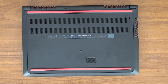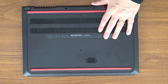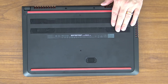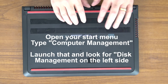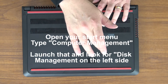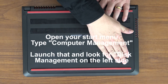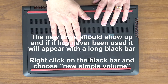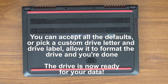Now if you bought a brand new drive, when you turn this computer on Windows sees it but there's no drive letter, because bare internal drives do not come formatted. You will need to go into Computer Management and partition the drive. Press your Start key, type in Computer Management, and press Enter. Go to Disk Manager on the left-hand side and you will see the disk listed below the solid state drive. Right-click on it, create a new volume, assign it a drive letter, it will offer to format it — say yes, and your drive is ready to go.